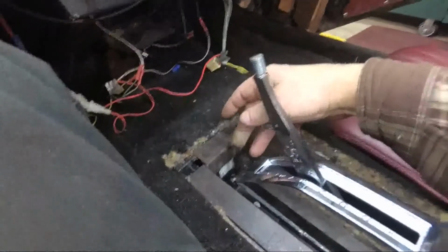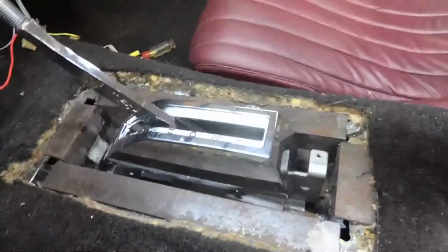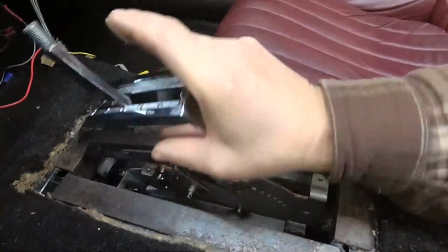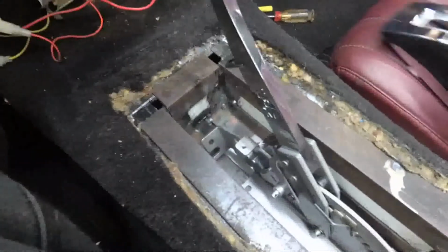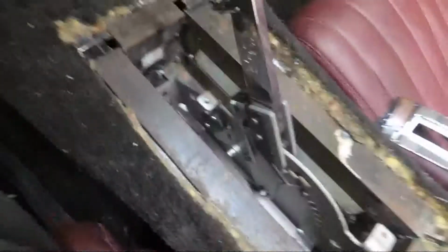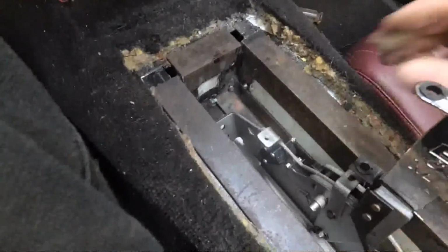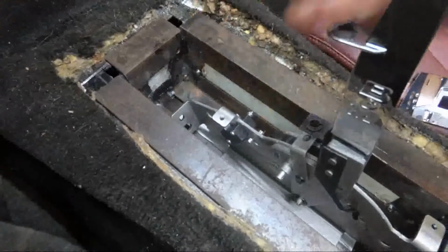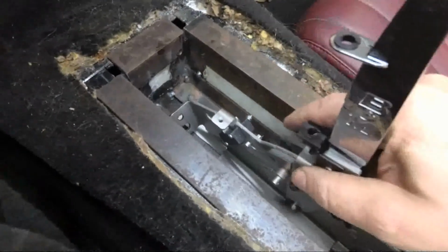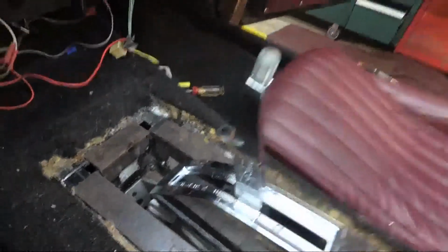And I even have room down in there for my relays, for my starter solenoid. And the cable's got to go out. I think I could probably drop the relays in. Yeah, they'll both fit on that side. Down in there. Backup light, and I'm going to put relays on the backup light and the reverse, because these micro switches here are a little fragile. So yeah, I can get that in there. Super. I like it. It's going to work.